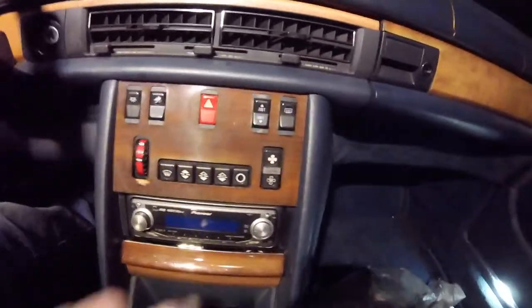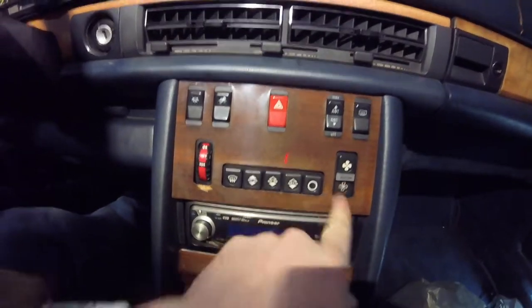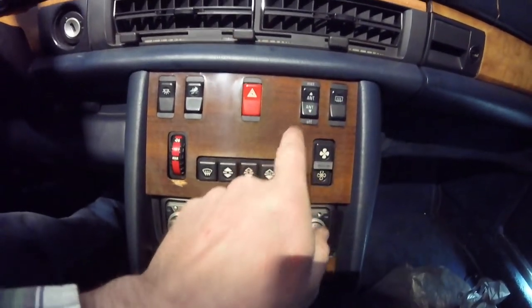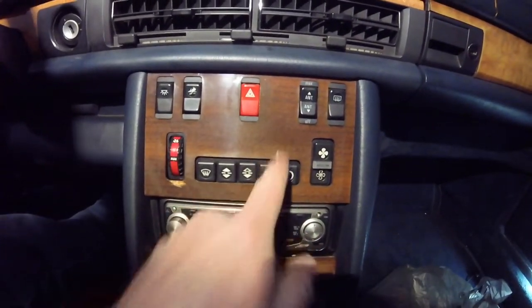It's dark out, that's what we've got to work with. What I'm going to work on now is trying to get the blower motor to work. It only works on high. When I hit the high button it only works, and this one doesn't work when it's on low. What I was told is there could be a break in a solder joint inside the control module back here. So I need to take the face plate off here and the bezel, and I believe I need to slide that down.